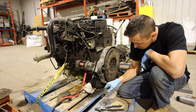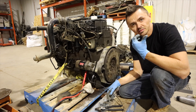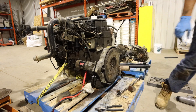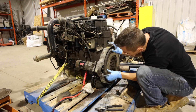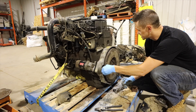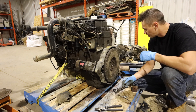We got the booster cables hooked up to the starter — positive on positive, negative on a bolt, and a jumper wire to act like the solenoid. I'm going to stand about six feet back and engage the starter to see if it'll spin. It seems to engage but the starter wasn't disengaging at first. After a little fiddling, my battery wasn't quite strong enough, but it's engaging and disengaging nicely now. I think it just hadn't been used in a while. We'll continue and throw the clutch and pressure plate on.